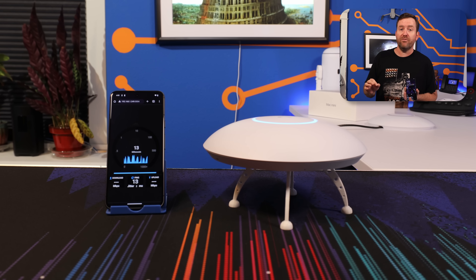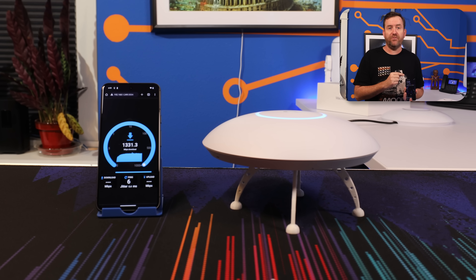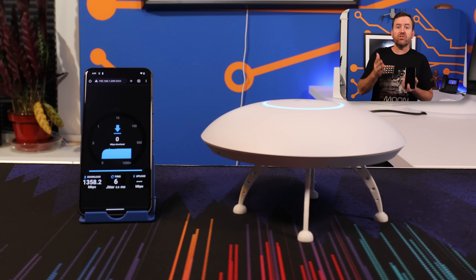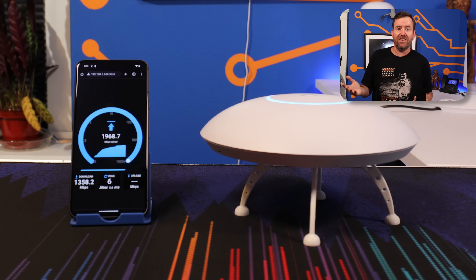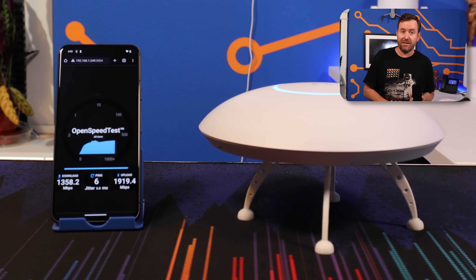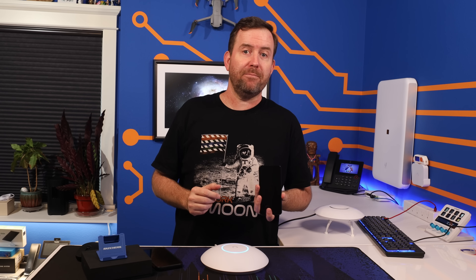This is also going to be very client device dependent. As you saw in my testing, the newer Google Pixel 8 outperformed the older iPhone 13 in both tests. But if you don't have any Wi-Fi 7 capable devices, it's unlikely that you'd notice much difference in performance with a Wi-Fi 7 versus a Wi-Fi 6 access point. Most normal wireless usage isn't transferring large files around the network and running speed tests — it's watching YouTube and surfing the web, which don't require gigabit plus wireless capability. And even when Wi-Fi 7 is standard on smartphones, it'll still be years and years before all of your other devices catch up. Content streaming boxes like Roku, IoT devices, printers — these things are all fine with Wi-Fi 5 or maybe Wi-Fi 6. It's going to be a long time before Wi-Fi 7 would be required in order to not bottleneck your wireless connectivity.